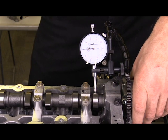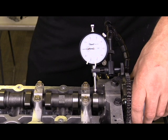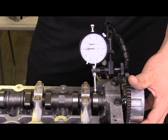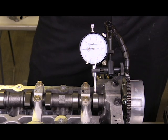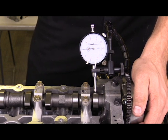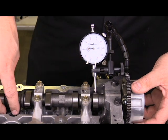The second method for measuring lobe lift is how much the camshaft lobe opens and closes the valves. I'm on the intake camshaft here in this particular cylinder head. I've removed the valves and valve springs — if you didn't want to do that you could measure this on V-blocks, but that's why I can rotate this camshaft easily. I'm on the base circle of the camshaft, and I'm going to use this dial indicator to determine how far that lobe presses up against the bucket to open and close the valve. I put my dial indicator on here, zeroed it out, and I'm going to rotate.